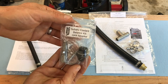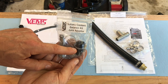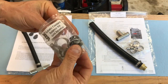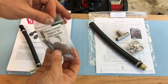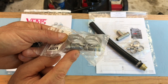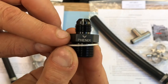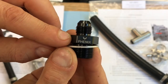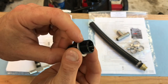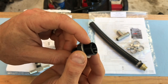This baggie also comes with the kit — it has two hose clamps and a little fitting that screws into the back of that cylinder head. The hose clamps look like they're stainless steel. This fitting is also from Phoenix Industries and it's got a little crush washer on it that should help seal it. The instructions will probably have you put a little RTV in here — I definitely would add a little high temp gray RTV.